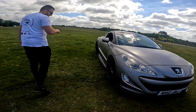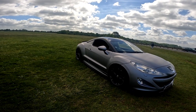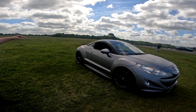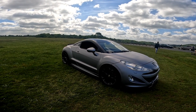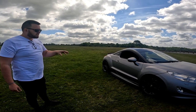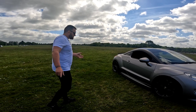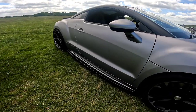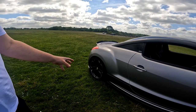As we walk down the side of the car, you can see that we have lowered it. It is on 30mm springs on the front and 25mm on the back. It sits a bit weirdly - not how you'd want it to sit - because it's still higher on the front than it is on the back, even though the front springs are meant to lower it more, which is a bit interesting. As you can see down the side, we've got the Maxton side lip - very uniform, very universal, everyone has them, but it does suit the look of the car really, really well.